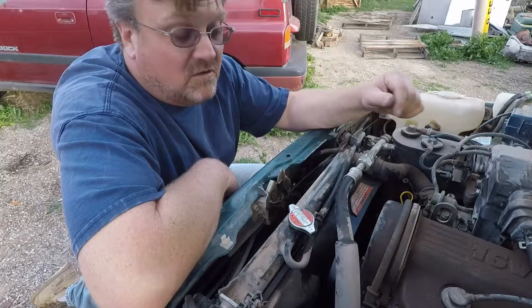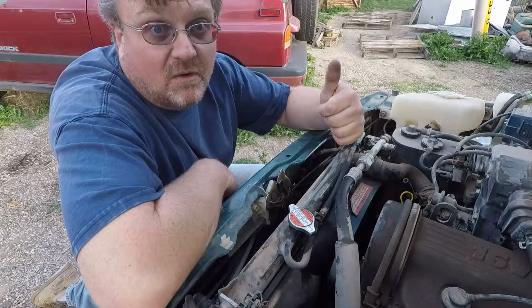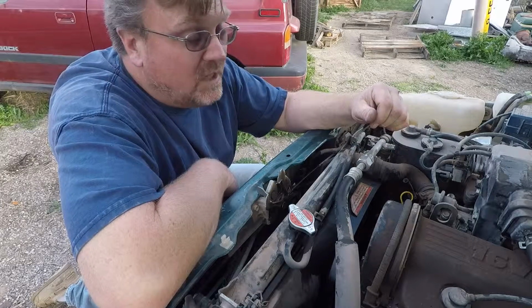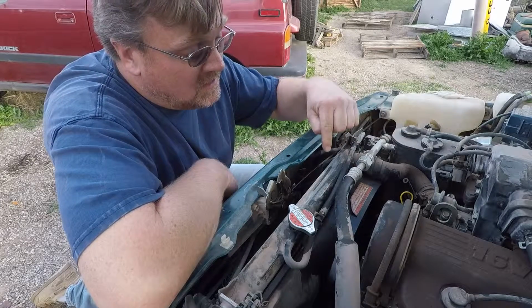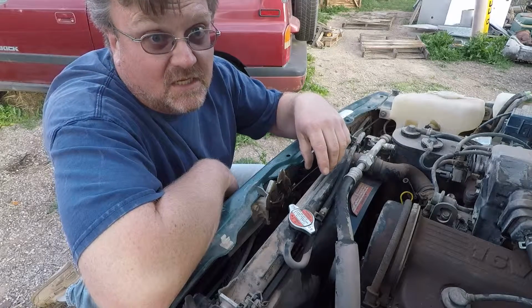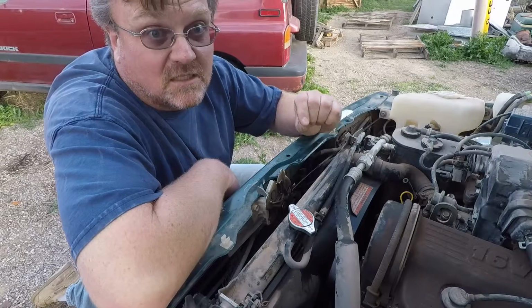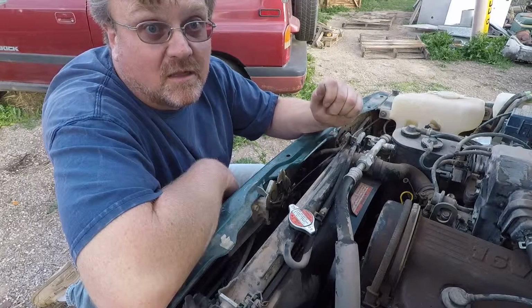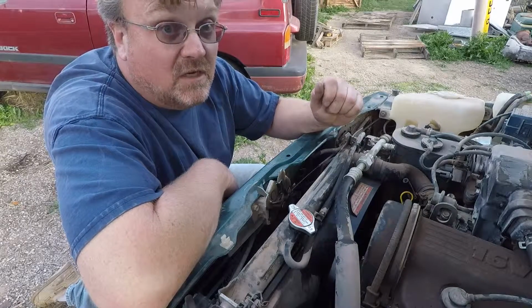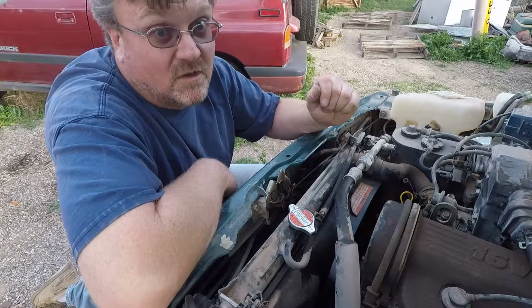Now that is not going to stick very well to this, especially when you have pressure of the radiator coming out and nothing behind it. So what I am going to do is drill holes through my radiator, attach a piece of metal with silicone in between it, so the silicone acts like a gasket rather than trying to seal it like a glue. I have no idea if this is going to work, but we'll find out. Who knows? It might be fun.